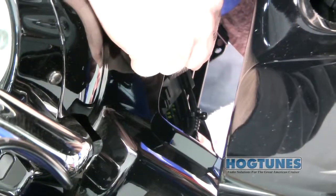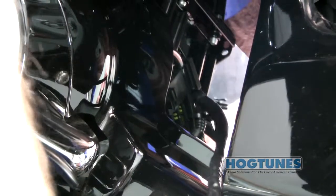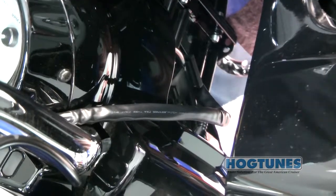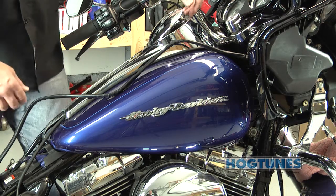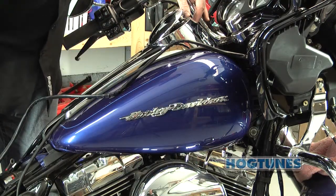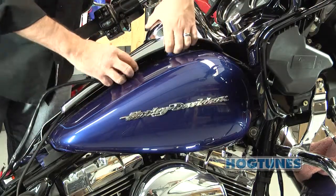The balance of the power harness will exit the inner fairing and go towards the frame of the bike through the wire passage from fairing to bike. Just in front of the tank, you will see a structure that attaches the fairing to the frame of the bike. The power harness will pass through this structure and exit through the rectangular opening where the factory harnesses also exit. You can lift the fuel tank if you like and run the wire harness under the tank towards the battery, or run the power harness up and over the tank but under the tank's chrome console as shown.